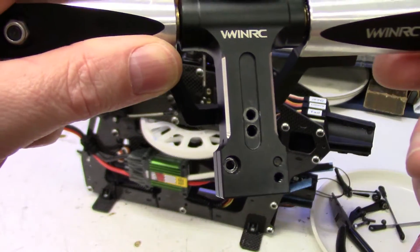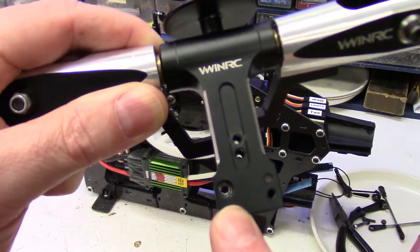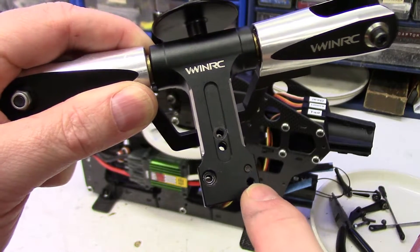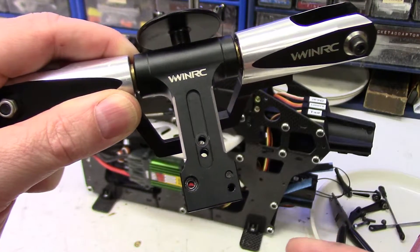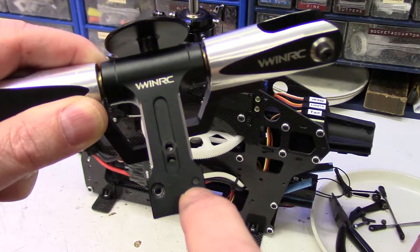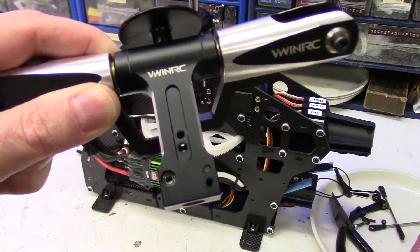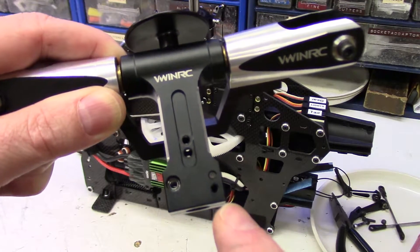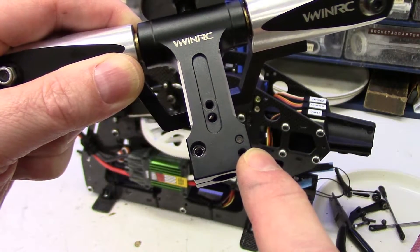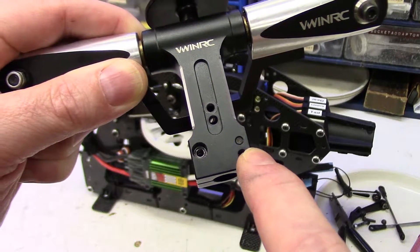The mechanics are out and the head is off. Hopefully we can get a better view now. There's the one that came out no problem, and there's the one that's stuck in there. The first part of drilling out a busted bolt is to put a center dimple on there so the drill bit won't wander. I'm actually going to use a small drill in the drill press to put a little dimple in there, then use a bigger bit — and hopefully the bigger bit will actually bite into that screw and thread it out.